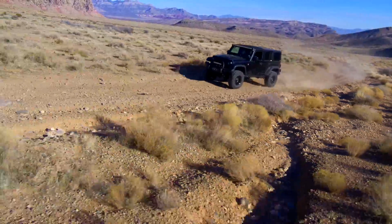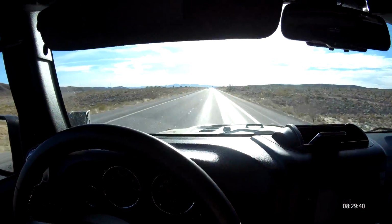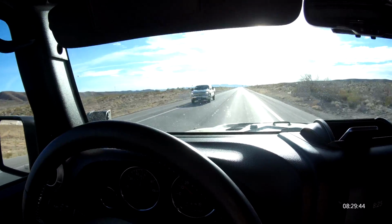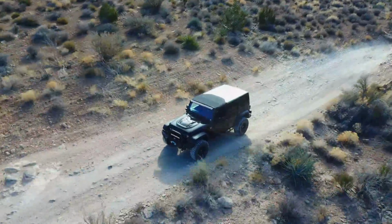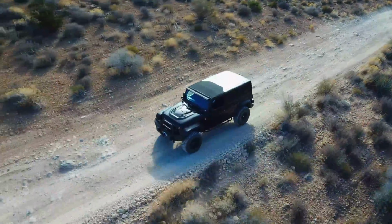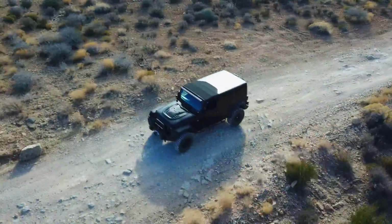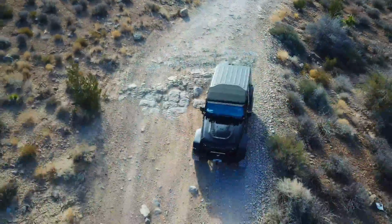In the truck operating systems, and even in most of the passenger cars, the body control module controls your tap shift, cruise control, has an effect on charging, power modes, that's waking up and putting your network to sleep so you have no draws, RPM match shifting. There's just a lot of functionality in the BCM that if you eliminated it would have to be replicated. So we ran a complete network and we had full functionality.